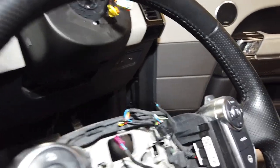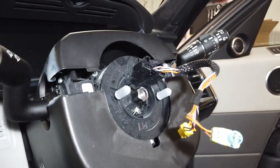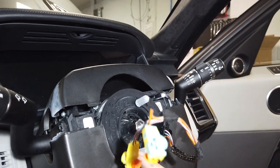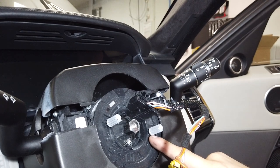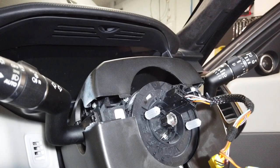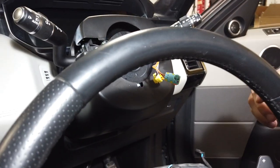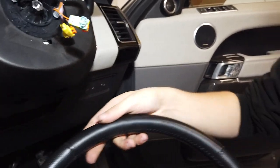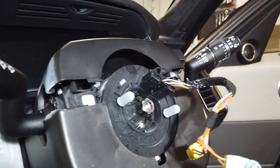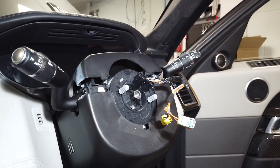The steering wheel is off now. We're going to have a look at that on the bench because we've got to swap the switch packs, the chrome trim, and that's the clock spring. Can you demonstrate how it turns — but don't go spinning that round and round because it only goes about four turns clockwise and four turns anti-clockwise. Leave it roughly where it was. When you put it back on you've got to make sure those grey pegs line up with the holes in the back of the steering wheel.